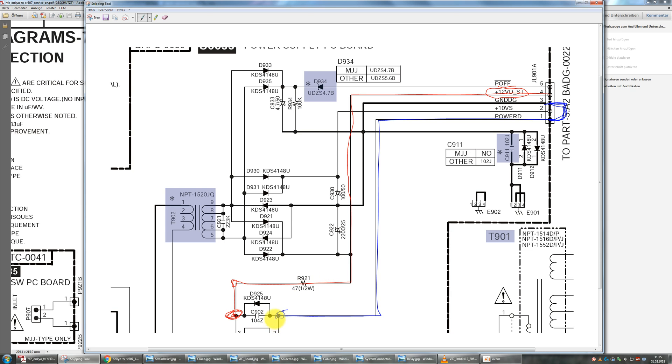In other cases, if the lower side of your relay is always tied to ground and you switch the high side, then you could just wire it straight. But in this case, since you're switching the low side, it's not possible because the low side always has to be ground on the subwoofer and you cannot have it switchable. So I needed to come up with something different.